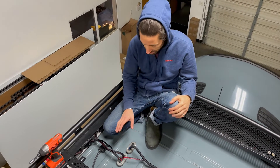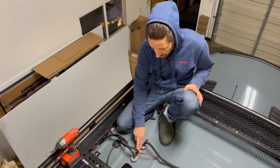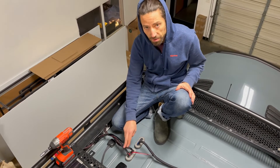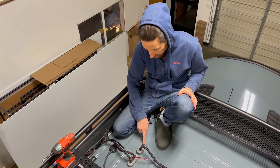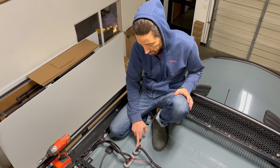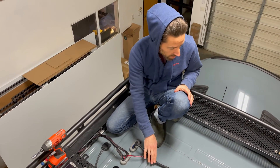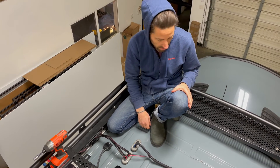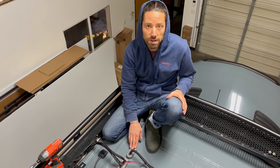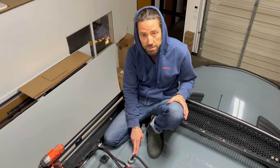We are wrapping up our cable pass-through project on this camper van. This one ended up with about 10 wires through it, and this one has six — all different gauge wires. We left some open space in the front DS-MULTIs for future accessories if needed. We put some loom around all the cables to keep things clean and everything came out perfect. All of the ScanStrut cable seals are available on nomadicsupply.com — go to Electrical, then Cable Seals to find all the different versions.